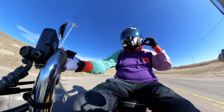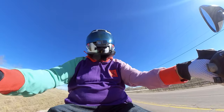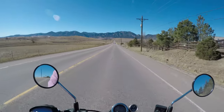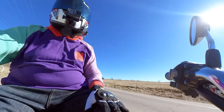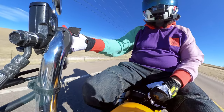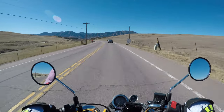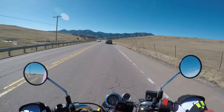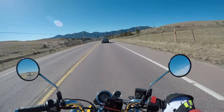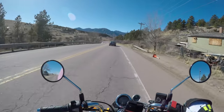That install wasn't too bad. The biggest problem was trying to actually fit everything in this small headlight bucket — not a lot of space in there. It is a small bike, so who can complain? The only other real issue was the instructions and the fact that I don't read Japanese. Using Google Translate, I was able to look at the manual, figure out what settings I needed to make for the tach, and make those changes so the tach actually behaved. It's nice having that tach there. With the cam and ECU on the bike, it's helpful to get as much information as possible while you're riding — now being able to actually see the RPMs, not just hear them, is quite beneficial. The ECU flash will have raised the rev limit up to about 10,000, which I've seen the bike get up to. Good to have a visual representation of that being done.